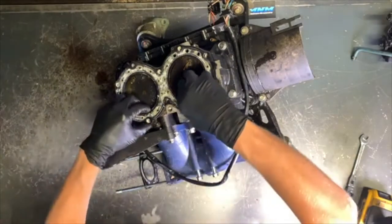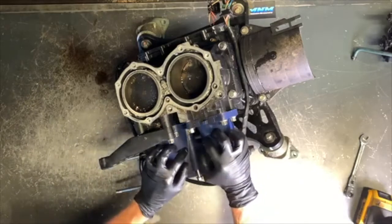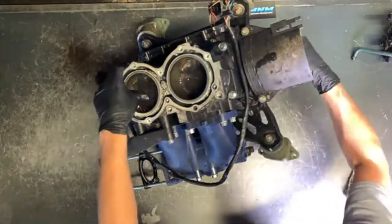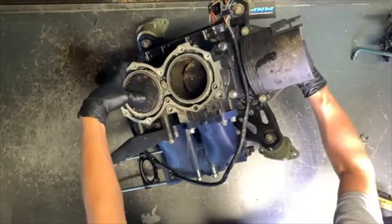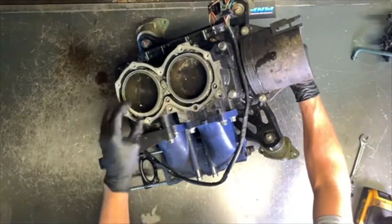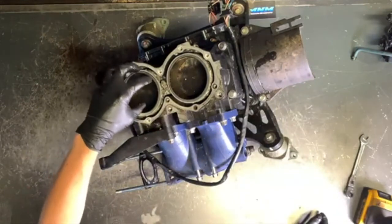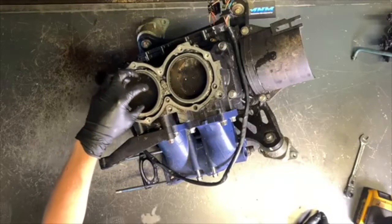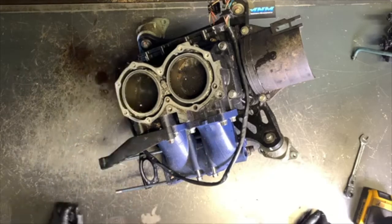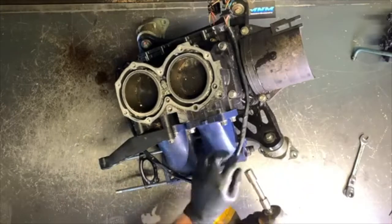Cylinder head is ready to pop off — there is your cylinder. These are called the domes — the cylinder head dome or cylinder piston dome. You want to make sure these are in great shape and clean any carbon buildup before going back together. Here is your head gasket — remove it and throw it away; you will not reuse that. Now removing the exhaust manifolds as we strip this all down. When rebuilding, make sure cylinders slide up and down freely and are bored to the correct specifications for each piston. Take it to a machine shop — don't just bore it out and hope the piston fits.